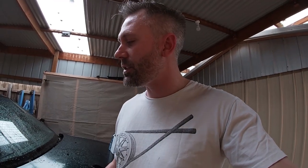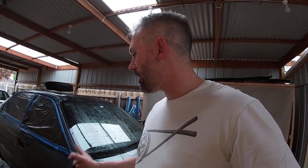I just wanted to take a little break from the sanding — because it's really boring and tiring — just to show you my progress. I'm far from finished. I'm just using some 240 grit to get most of the clear off. The reason I'm doing that is because I want to see the high and the low spots in the paint, because even though you may have some dints that are clearly visible, some might not show through on first inspection.